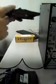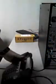After you get all those connected, it's time to put the base on. This is the tab for the base — the ramps go toward the telephone. Make sure all of your cables are up underneath it. You're going to angle that tab into the bottom slot on the telephone, push it in, make sure all the cables are clear, and it should snap into place. Once that's done, take your curly cord. Note that the jack on the handset is sideways on this one, so you'll want to turn it, plug it in until it clicks. And that's it — you're ready to go.